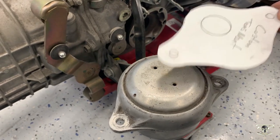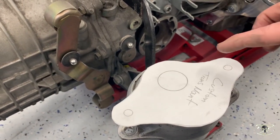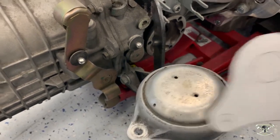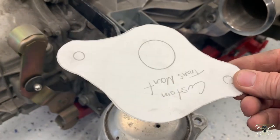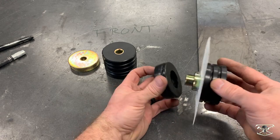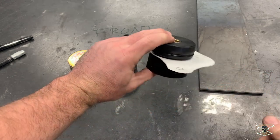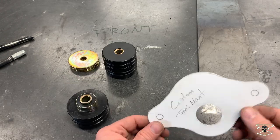I've come up with this template based off the OEM Porsche mount, which gives me the two mounting locations here and here, as well as the off-centered mounting location with the through bolt that goes to the side mount on either side of the transaxle. We're going to transfer this over to steel. These polyurethane mounts are made for a through plate of steel in between two plates which get sandwiched together, giving you the same structure as the original OEM Porsche ones. Now we're going to transfer this over to steel and get our three holes drilled out.